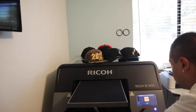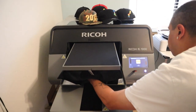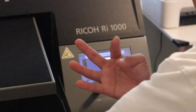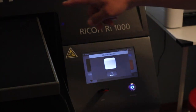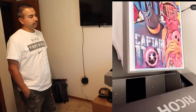The machine displays an 'Object Detected' error, meaning the platen is set too high. To fix it, you drop it down by turning the knob clockwise and wait for the indicator to turn gray. Once the sensor confirms it's at the right level, you're good to go.